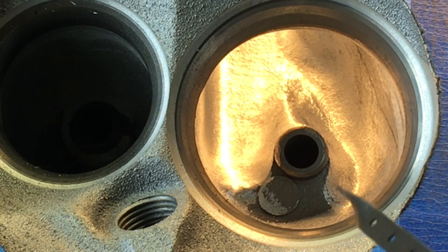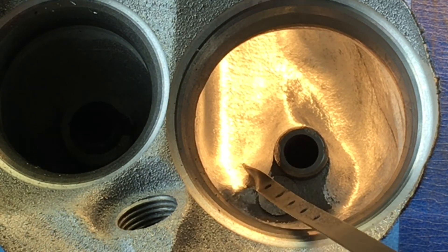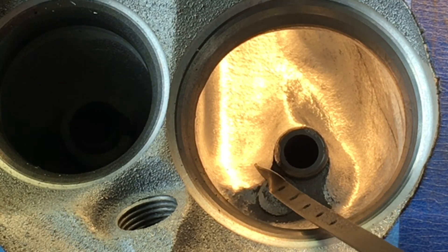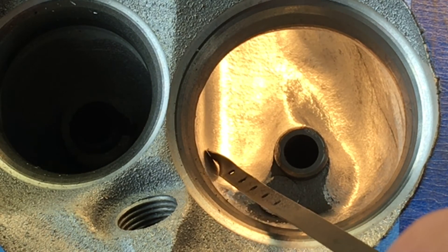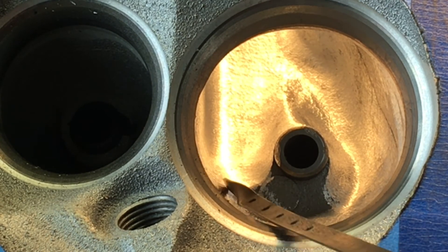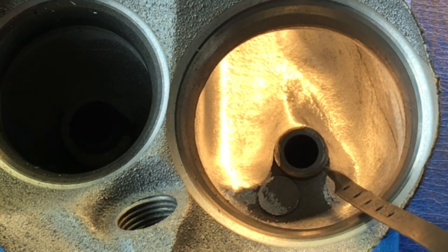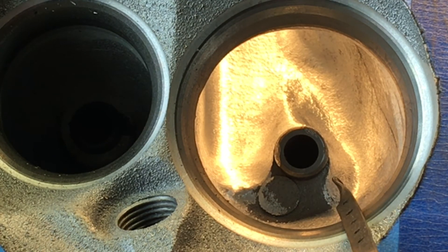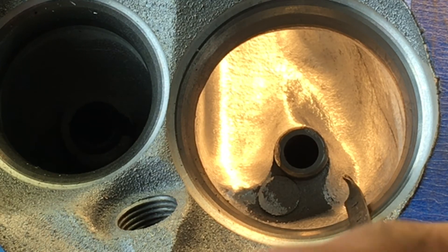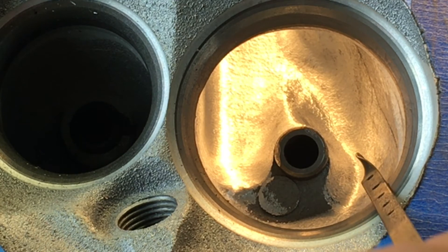On this 215cc port, I have made a nice transition, removed that swirl ramp, and this comes smoothly into that wall and then the back wall. You can see where the valve guide boss is even more reduced than it was previously. We have pulled in towards the valve guide boss, creating a nice smooth channel or airflow area on the short side.